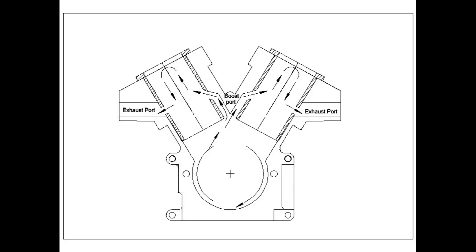But we are using two cylinder liners facing opposite directions, as seen on the next diagram. Also consider that the crankshaft tends to fling the air-fuel mixture in the direction of its rotation — we question what happens when it has to turn the corner to get into the left-hand cylinder. Does it tend to prefer to just go into the right cylinder and cause the tuning issue between the cylinders that we have experienced? We'll try removing the boost port and see what happens.